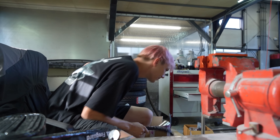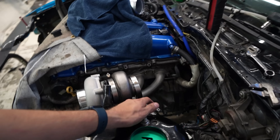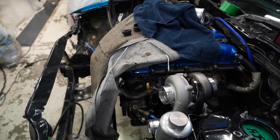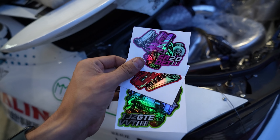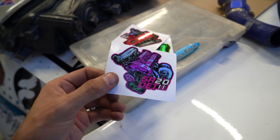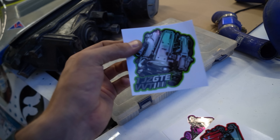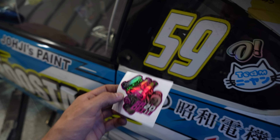That's a perfect oil drain line. We just finished changing out the springs in the wastegate so that's all set up and good for starting at around 16 PSI — about 1.2 bar — and then we can ramp it up from there. Kawai-san's finishing up welding the support bar. We recently added holographic engine stickers to Samet.net — SR20, RB28, and 1JZ. We're going to do a batch in a couple months in a different glitter holographic style too. It seemed like the perfect time to stick a nice little SR20 sticker somewhere on this car.